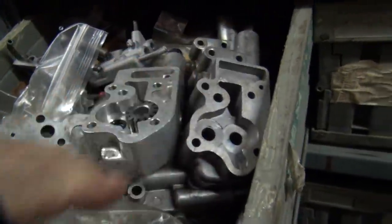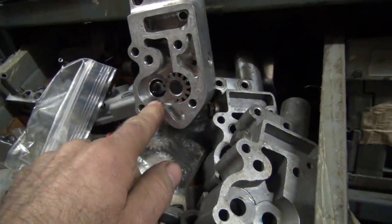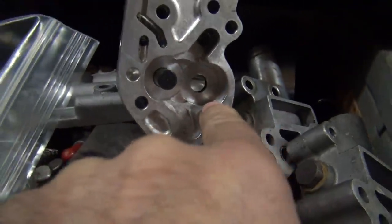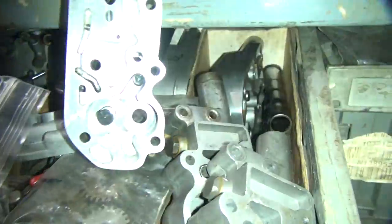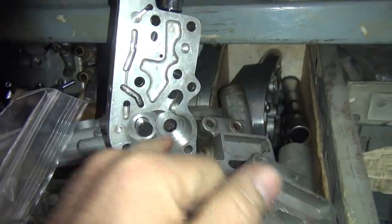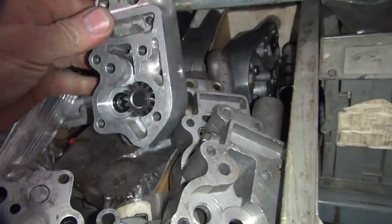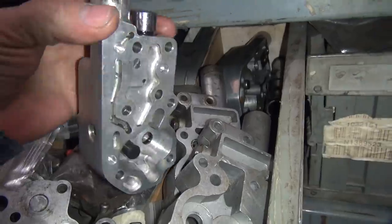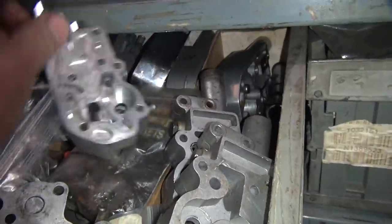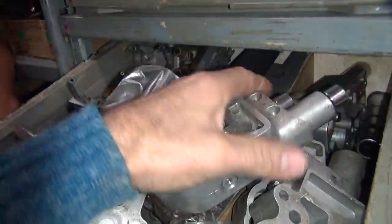All these pumps are all very similar in how they work, so it doesn't matter what year you got. Here's an oil pump - this is called a small gear, big gear. The big gear is called the return pump because it has a bigger gear on it. The smaller gear is for pressure. The difference is the return side has to pump back all the oil that the pressure gear put in, plus a lot of air, so it has to be more volume. Otherwise you have a wet sump problem, which means it pukes on the ground.